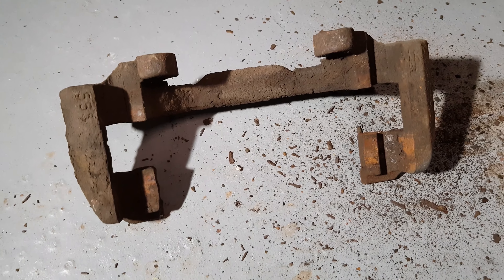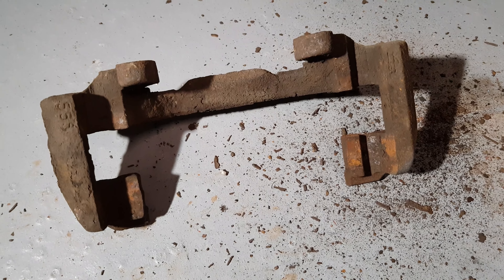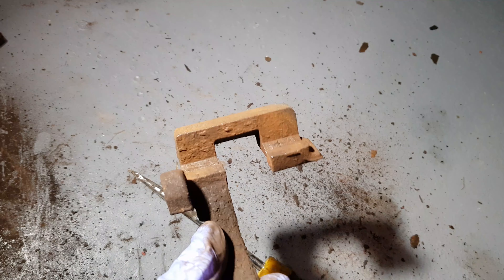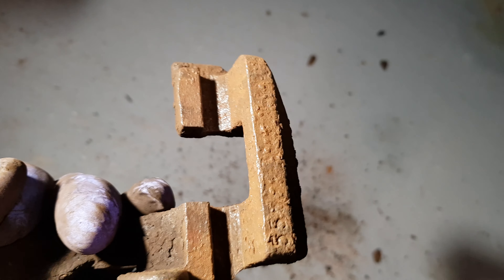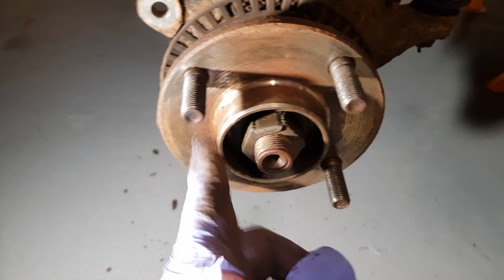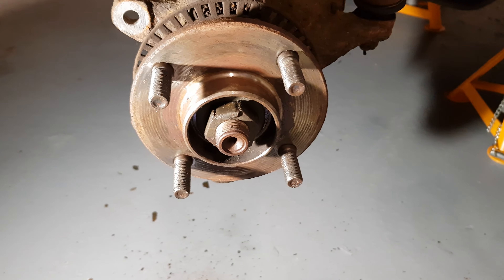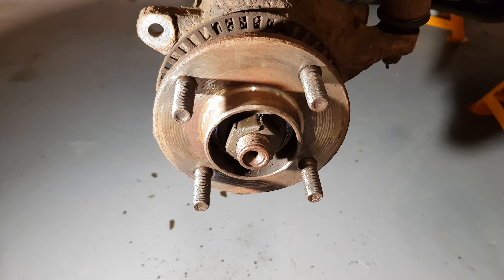There are literally two 13mm bolts on the back. They can be rusted sometimes, can be quite hard to get your socket on — it's better to line the socket on, give it a waggle, get it on, or hit it slightly with a hammer. When dealing with anything brake-wise it's best to wear a mask — I'm going to wear one in a minute when I start cleaning all this gunk off. Let's get this cradle off now and we can get the disc off as well.